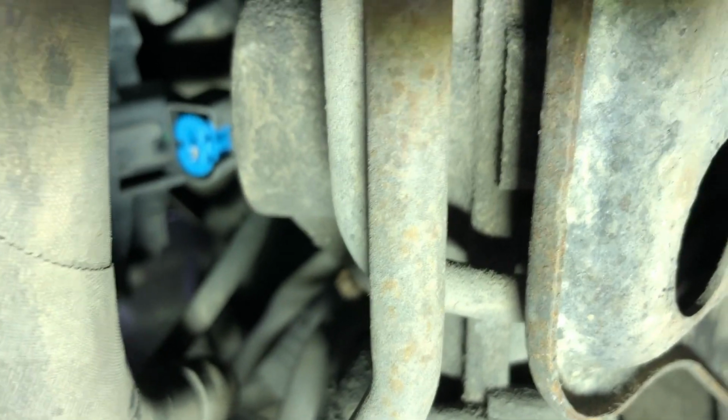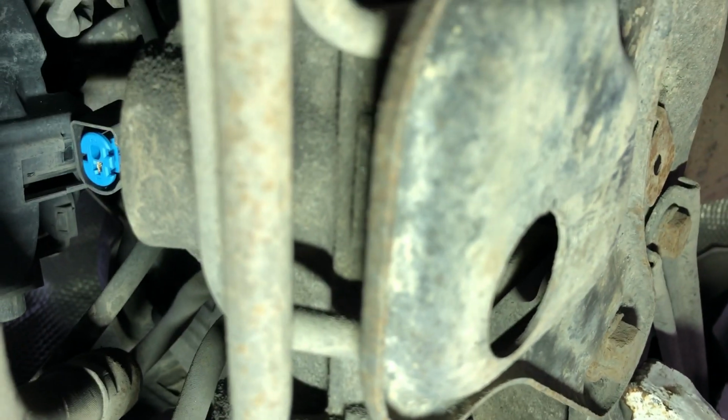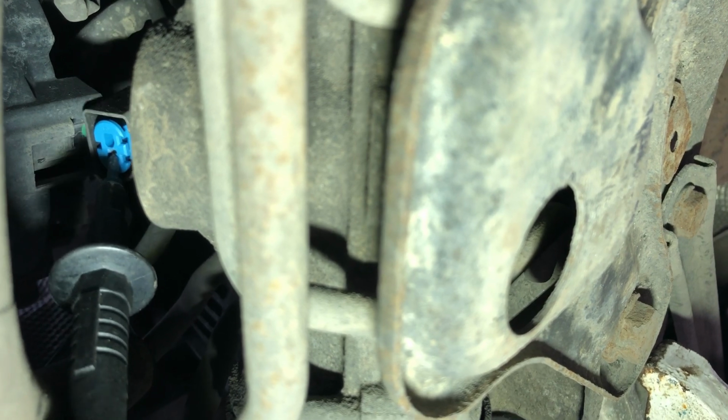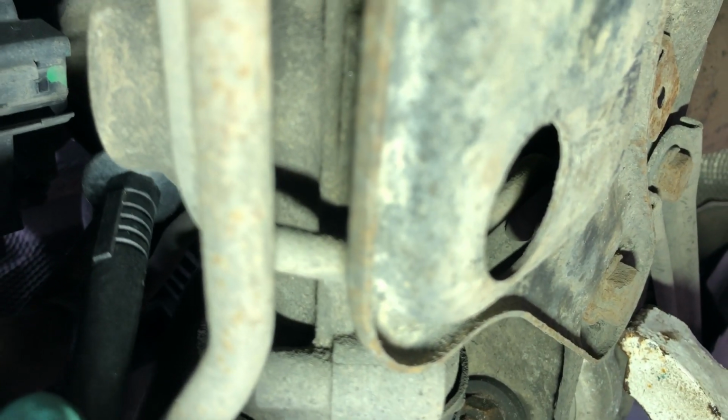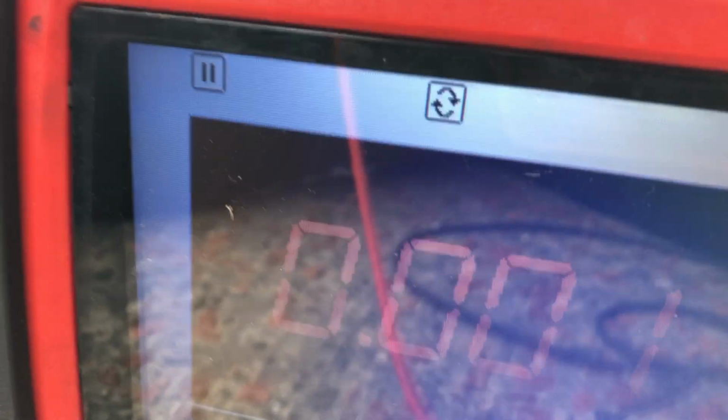Going from underneath. Right, here we are underneath this Merc here. I've got the plug off the alternator there. It's a bit of a precarious place. I think you can hear that beeping. That's telling you about continuity. So this fault may not be just as simple as a broken wire. I'm going to have to plug the engine ECU in and scope the LIN bus and see what's going on.